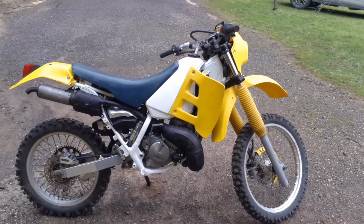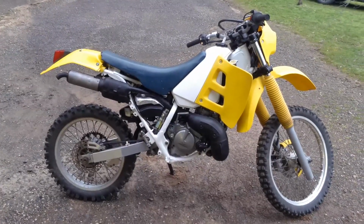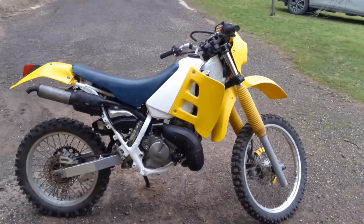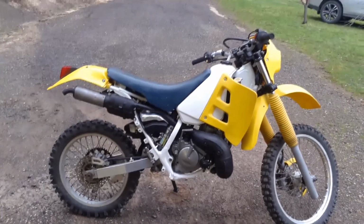Well, the little bit of fuel I put in it has run out. I've had a look in the oil reservoir. There's more than enough to last quite a long time, so I'm not sure why the low oil light's on. It's a pretty simple system. It's just a couple of contacts with a float. It's not a resistance reading, so there's nothing that should really go wrong.